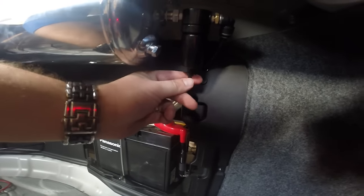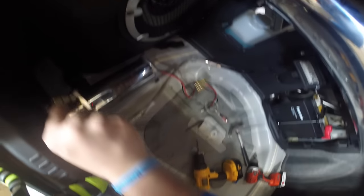So what I did here guys is I ran the compressor line right there — it goes back through the wall, comes behind, and goes right in there. Then I ran the tank feed line in the back of the tank, through the wall, back around there, and it comes up through here and goes into the management. The other line there is just an exhaust line. I found out that AirLift doesn't give you a ton of the tiny quarter-inch line, so I need to buy more for my drain — I used all of it up here on top, going around behind the subwoofer over here to the pressure relief and the fill line.